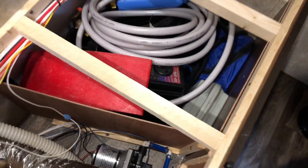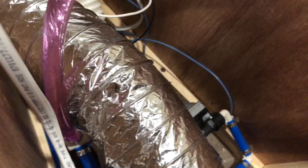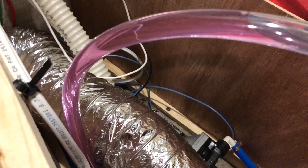The water pump in the Hummingbird 16FD is located here in the dinette area under the dinette booth on the driver's side of the trailer. You can see it's right here. There's going to be this hose — I've already started — and all you do is just pull this hose out and drop it into your gallon of antifreeze. Down here there's actually a valve, and you're just going to want to turn it. What that's going to do is instead of drawing water up from your fresh water tank, it's going to shut that off and draw from this hose that they've included. You don't have to attach anything — it's just in here hidden. And then when you get all done, you'll just want to switch that back so that next spring it'll be drawing from your fresh water tank. So once you have your hose and switch your bypass valve, we're all set to go.